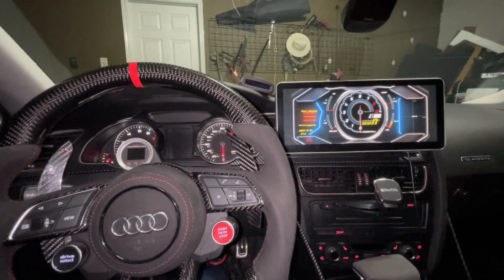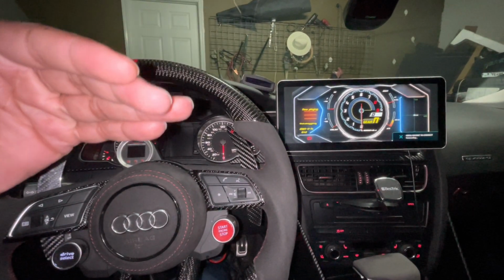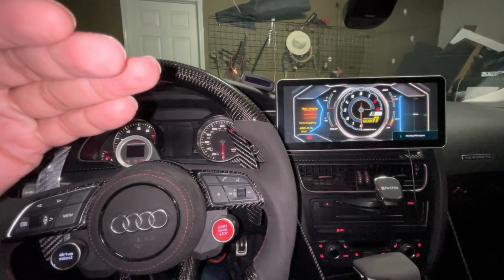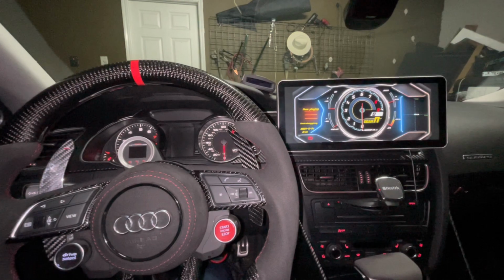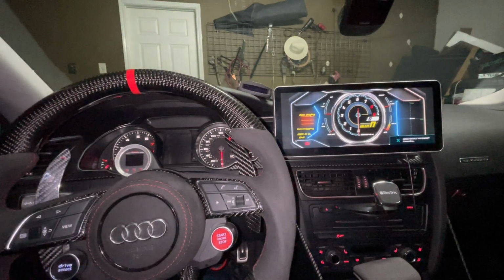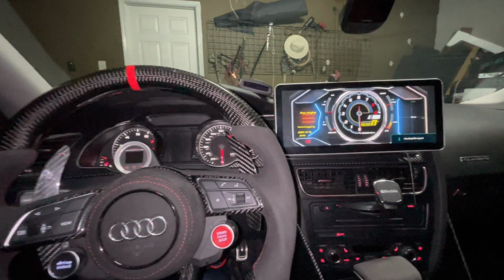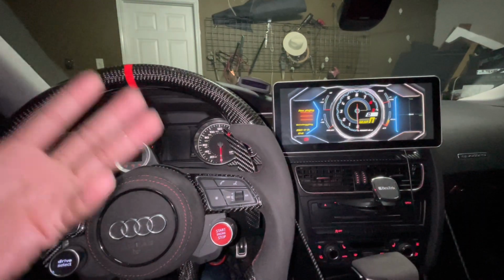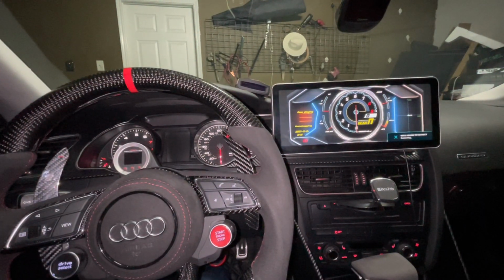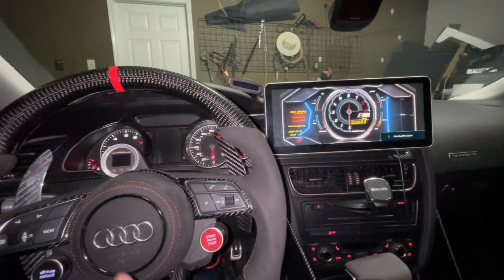And the reason why I'm doing this video is because if you put too much oil in your engine, there could be some adverse effects that can hinder your engine, the performance. The oil cannot be compressed properly. You can get some bubbles that can just hurt your performance, and overall your engine won't be lubricated enough. And of course, if you don't put enough oil, you can endanger your engine of having some issues with your pistons and your rods and not enough lubricant to keep your engine running the right way.